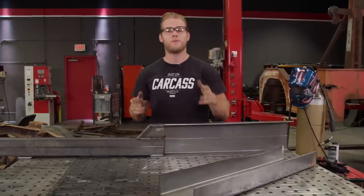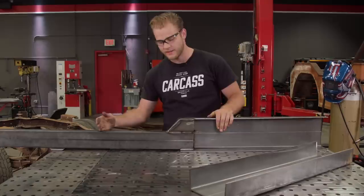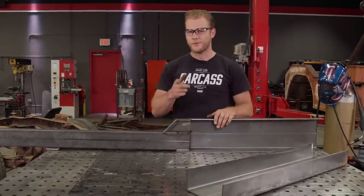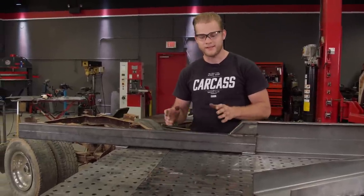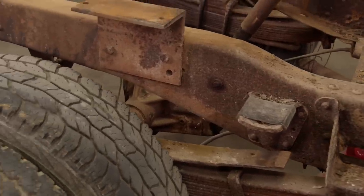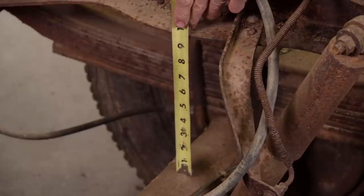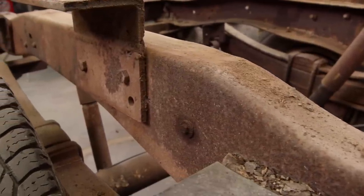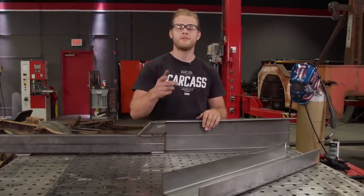During the break, we built one chassis rail of our back section using the C-channel we made, a straight piece of rectangular tubing, and we added a gusset for some strength. It's currently sitting upside down on this table. One thing I wanted to point out — this section is a straight piece of tubing. On a stock truck chassis there's a kick-up to give clearance for the axle as the suspension travels. On ours, it's about 9 inches between the axle and the chassis. By using the straight section we lose some of that room, but there's still plenty for the suspension to travel. Now we're going to show you how to build the other half.